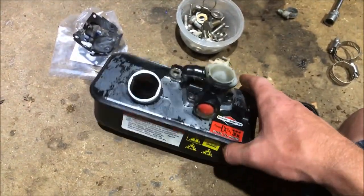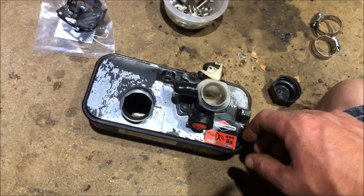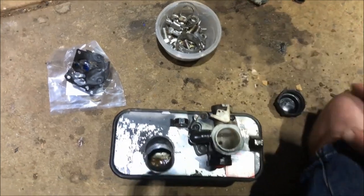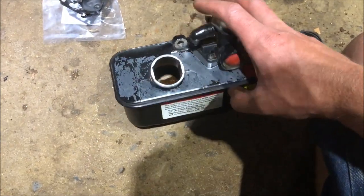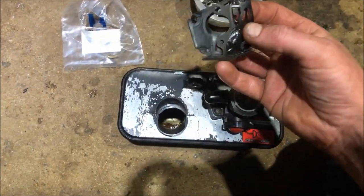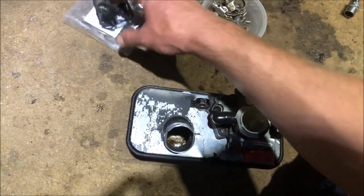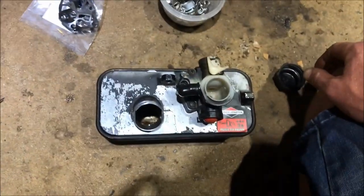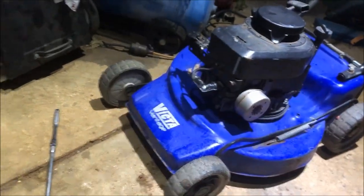So I've just chucked a new diaphragm in this carb. There's a little bit of rust in the bottom of the tank - I did plan on changing it out but I didn't have a good one right at hand. So all I did was, with half a tank still in it, I chucked a whole heap of stainless bolts and washers in there, shook it up, and got everything that was loose out of there. All that stuff is pretty much stuck in there but it's not going to block up our pickup, so it's not going to be an issue. These gaskets did need changing - usually I can get them off in one piece but it was just knackered. So they can go in the bin now. There's plenty of tutorials out there on fitting these; I will do one sooner or later. I've just got to organise for someone to hold a camera for me or get off my arse and buy a tripod. We'll fit this back onto the machine and carry on.